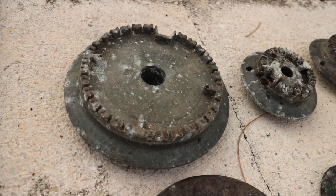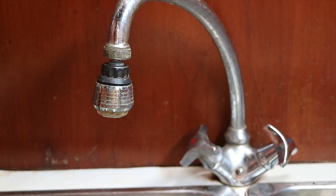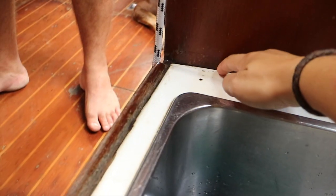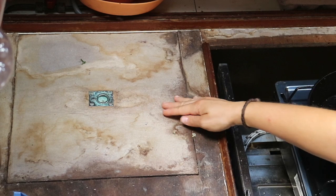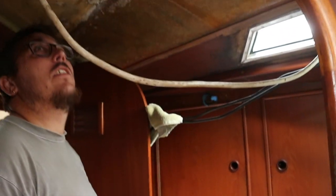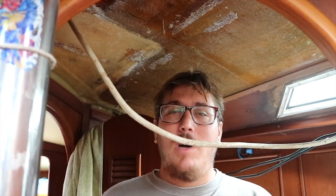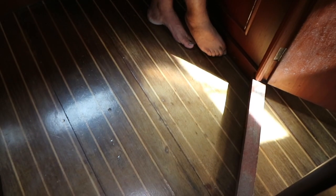Now we've got a $15 temporary fix — we can cook and boil water on the boat right now. The plumbing is high on my list of priorities. It currently uses an electric pump which, if left on, puts pressure on the leaky faucets and causes countertops to become soggy and blister. I prefer manual foot pumps — all else seems barbaric to me. I tried to take off as much of the peeling white stuff as possible, but wires are hanging all over the place. We removed the top lining and now we're going to have to scrape, sand, and paint, but also rerun all the wiring from the mast back to the electrical panels. As you go forward on the inside, there are less problems — though this window has leaks and this floorboard took a hit; we'll cut it in a straight line and just replace the piece that's rotten.